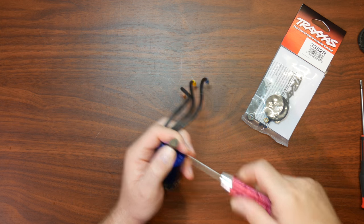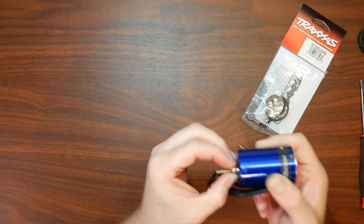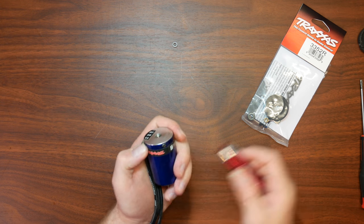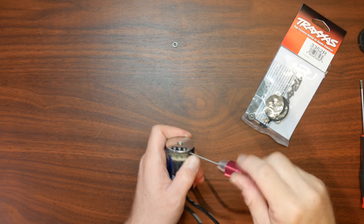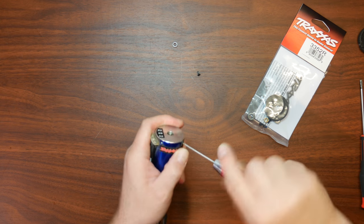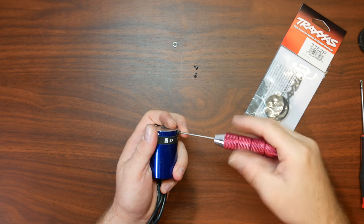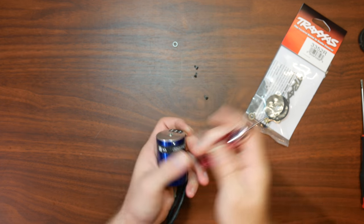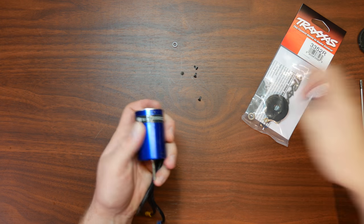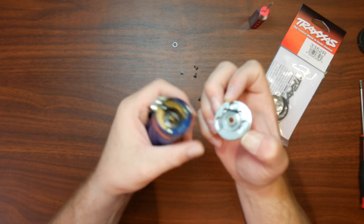The other thing we want to do is remove the pinion. And here we go — part of the bearing, not good. Now basically what we're going to do is remove all four screws that hold the back cap. Sometimes they might be a little bit harder to remove because they are loctited. Once you get one of these removed, you can remove the plate — it comes off.